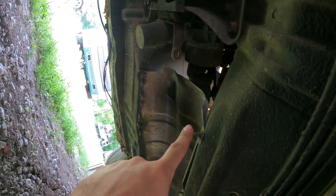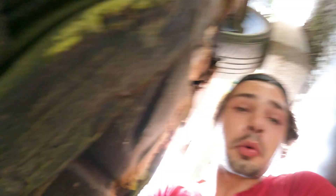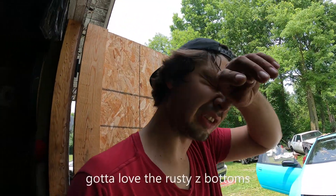Floor is all finished officially. I was short four crucial tools to do the job, so it took like five times as long, but it looks good. Whole exhaust removed. Now we're going to remove the heat shield — six 10 mils, two bolts and four nuts. We've got a 14 mil for four rear bolts on the diff flange, and a 17 or 19 mil for the carrier bearing bolts. Got our driveshaft out and the carrier bearing — it is incredibly hot and humid. The amount of force on those carrier bearing bolts was ridiculous because of how rusted and seized they were, even with PB Blaster on them. So we're going to sit down and dry off a second, and then we're going to work on our shifter, trans mount, and bell housing bolts.